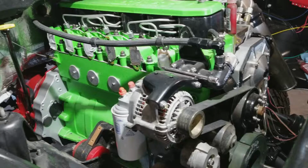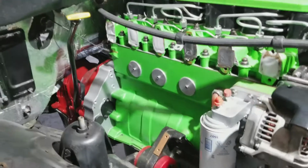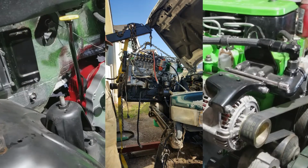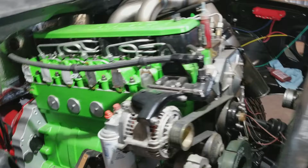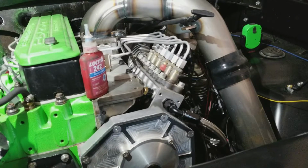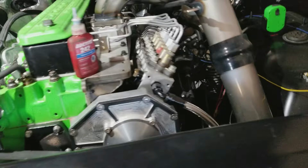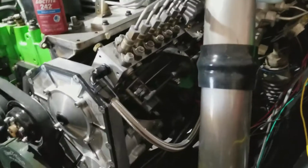Power Driven Diesel worked on getting this turbo set up. We're going to run a 364.5 SXE with a 488 over the top of it. We're going to do a side-by-side setup so we can run the hood stack and all that. They said the fuel setup they'd recommend would be a Firepunk Diesel Stage 5 13 mil pump with probably 5x20 injectors. I've done a lot of work on this, trying to eliminate all the factory wiring. We're going to take that ECM off. We don't need it over there.